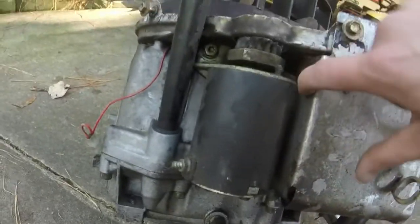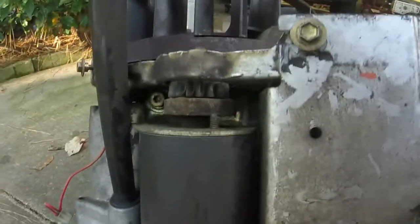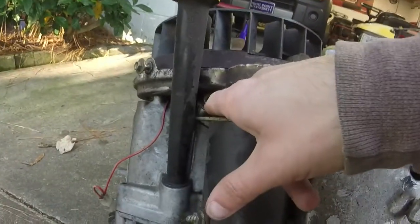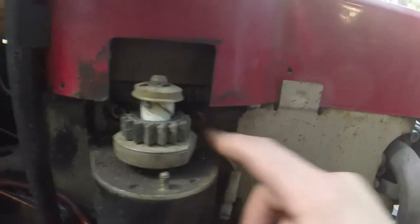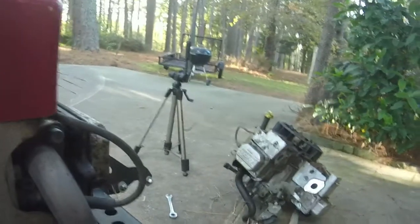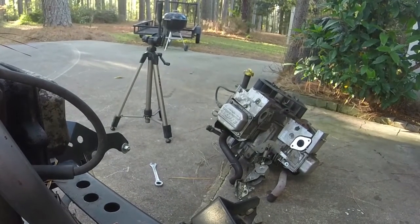The twin cylinder one is going to be a little tricky because of the shrouds around it. You have one bolt right here and the second bolt is right there — they're both half-inch. You can also use a star bit, but I actually just broke my star bit trying to get the single cylinder one off. Single cylinder access is a lot easier because you can access the bolt with a half-inch wrench instead of it being tucked away on the v-twin.